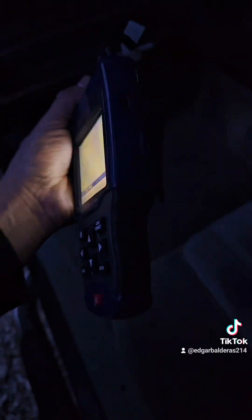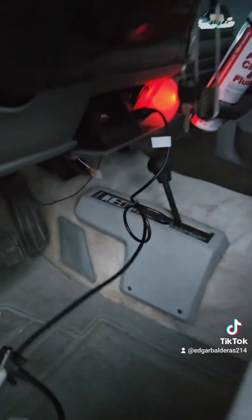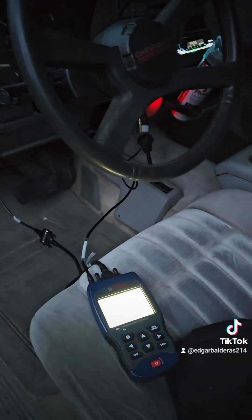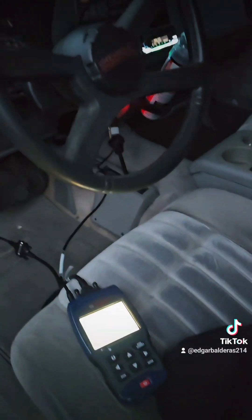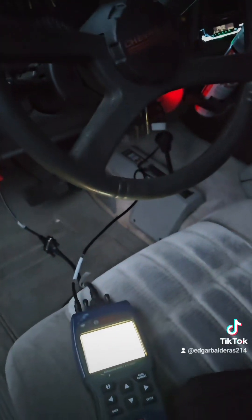If you can't find one locally, make sure it says on the bottom of the screen 'Enhanced OBD1 and 2 scan tool,' and it comes with all the accessories because you need that special OBD1 or ALDL connector and you need the cigarette lighter adapter to use this. If you want to see your live data, get a tool like this — it makes diagnostics easy to find. Good luck guys!